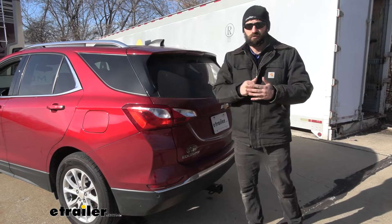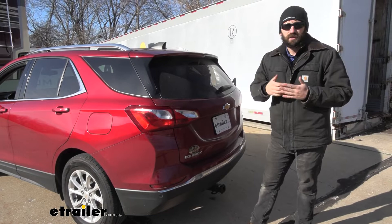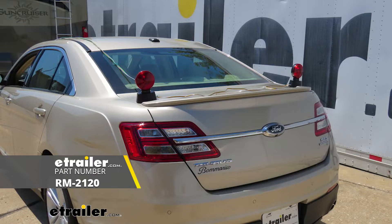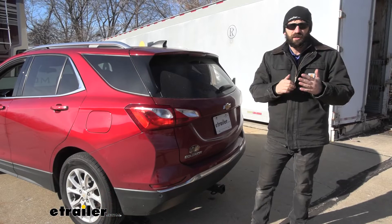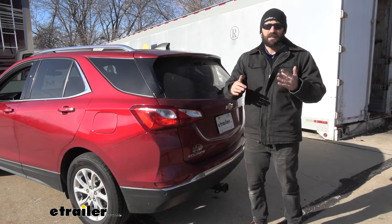I really don't like the bulb and socket kits — there's not a lot of room for error with the drilling, they can lead to leaks and possibly damage the taillight housing. Another option, which you've probably seen before if you've flat towed or seen others flat towing, is a simple magnetic set of lights that sit on the hood of the vehicle. You run a wire over the roof into the motorhome. Those do work, but they're usually not the greatest option — you have to deal with scratching of the paint with the magnet, and they're also unsightly because you're routing that wire over the roof. Definitely not a permanent solution.